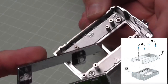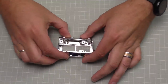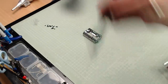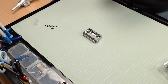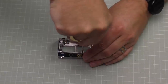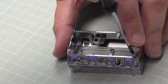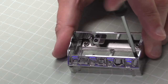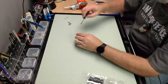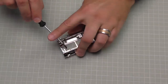We need to align the inlet manifold on top of this section, so this is just going to fit on top like that. It's going to be screwed into place by four AP screws — in this pack it looks like there's nothing but AP screws, quite a few of them. We're putting four of them in here just to hold that into place. Now, you're going into plastic, so you don't need to put oil on these. Just be conscious that you don't do them too tight — just hand tight will be ample, otherwise you risk rounding the screws in the holes. All of these parts are plastic, so bear that in mind.